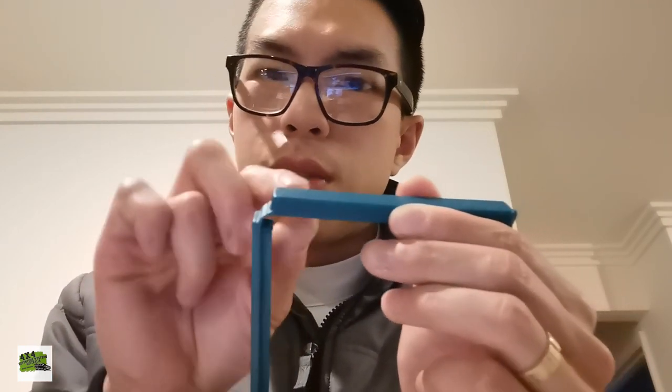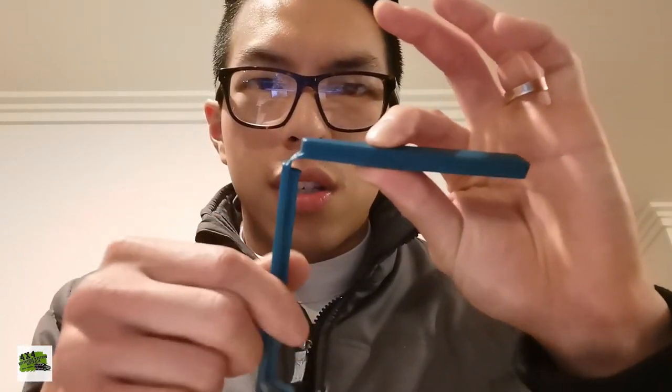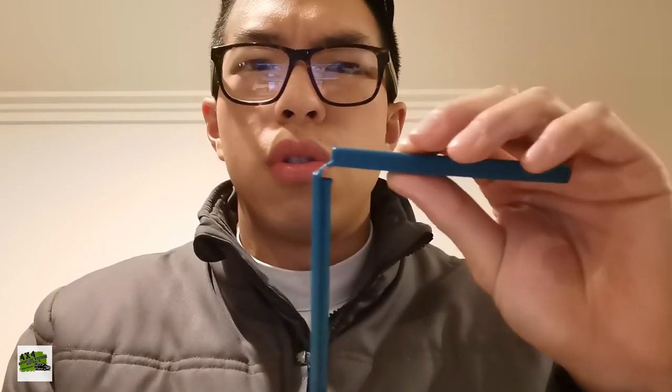So, and that is why this hinge needs to be very, very strong, and you preferably want to have some supporting structure as close to the hinge as possible. Otherwise, if you don't have anything here supporting this hinge, the whole awning will be twisted and is very prone to be damaged. And not to mention the self-supporting properties, it will not be self-supporting anymore.